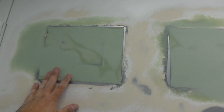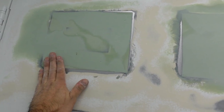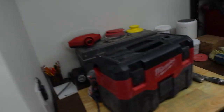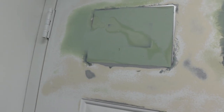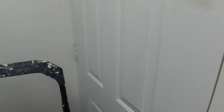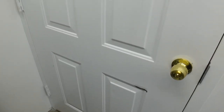This one, we have a couple of cavities that have to be covered, and there's a bit of a divot here because I did try to pressure to see how deep that went. So I'm just gonna take the spackle knife, which is this. I'm just gonna do a nice tight squeeze, like a nice little film on top, and then sand that off. But I'm gonna be doing that off camera because you guys get the point of this. I'm going to be making them all flat like this, every single one. But not on this video, obviously, because you guys can see that it's finishing up.